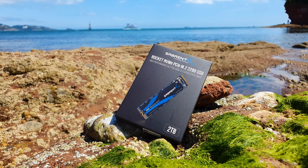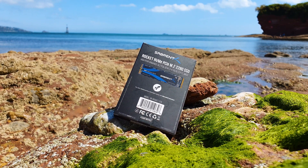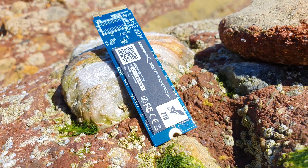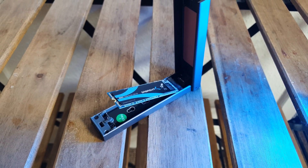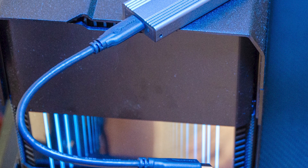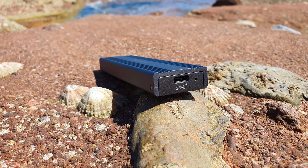Conclusion time. Despite being the veteran of Sabrent's NVMe lineup, the Rocket series has earned its place because of its great overall performance-to-value ratio. The Phison controller and TLC cells deliver exactly what you need and expect from Gen 3 x4 bandwidth, and it has even managed to surpass newer drives in the charts. The only negatives are its double-sided construction — which may not suit ultra-slim notebooks — and the small SLC cache given its fairly large capacity. As for the enclosure, it's truly a jack of all trades: 100% toolless thanks to the hinge design, supports both NVMe and SATA-based M.2 SSDs in the most popular sizes, and keeps the drive cool. The only limitation is the 10Gbps bandwidth ceiling, but for the asking price you can't beat it.